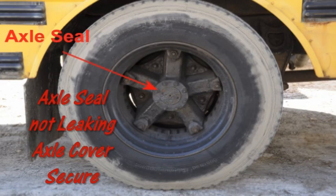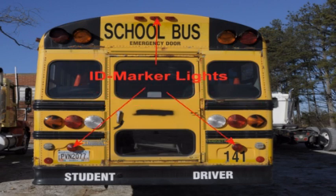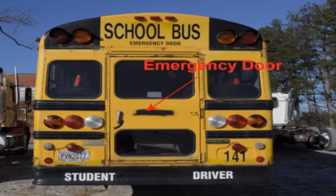Check the axle cover to make sure there is no damage, leaks, or missing nuts, and that the nuts are properly tightened. Check the alternating red and amber warning lights — each should be present, not cracked, broken, or dirty, and be the appropriate colors of red or amber. Check the marker and ID lights to assure they are not cracked, broken, or dirty, and are red in color. Check the lights and turn signals to assure they are not cracked, missing, or dirty, and are red in color. Check that the emergency door is securely mounted with no damaged or missing parts on the hinges, and that it opens and closes freely and has no broken windows.